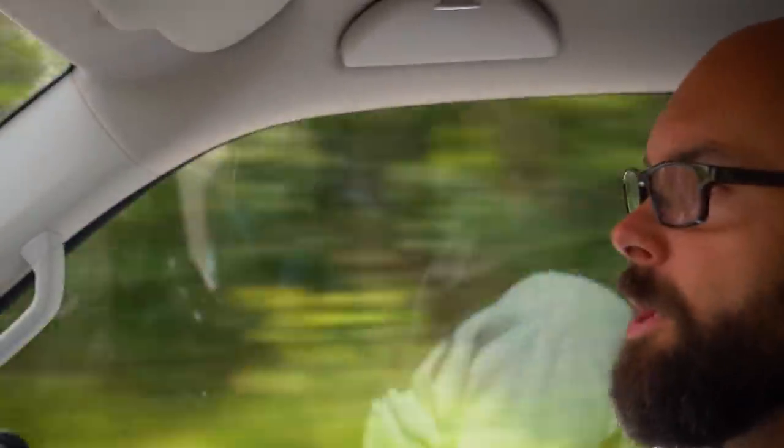We've done a nice long pull, you're putting the vehicle under quite a lot of pressure, and that's really good to look at things like the exhaust gas temperatures. The higher gear you're in, the longer the pull, the exhaust gas temperatures tend to get a bit higher than they typically are just from driving around normally, because you're putting it under that much pressure.